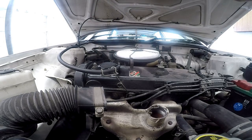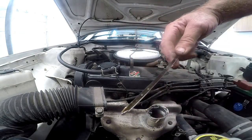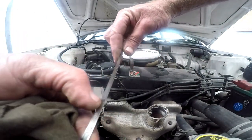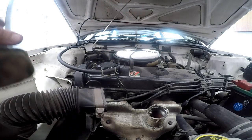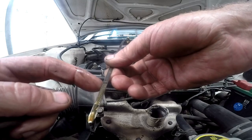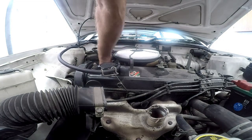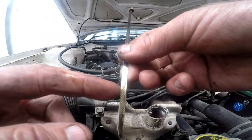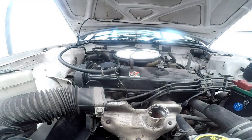Let's see where our level is — you can see how nice and clean the oil is compared to before we drained it this morning. It seems to be on the maximum mark. Let's just go again and make 100% sure. We're just about 200ml short, so I'll put in another 200ml. Take the dipstick out again and now we can see it's on the full mark. The oil is nice and clean compared to this morning — that's the difference that flush makes.